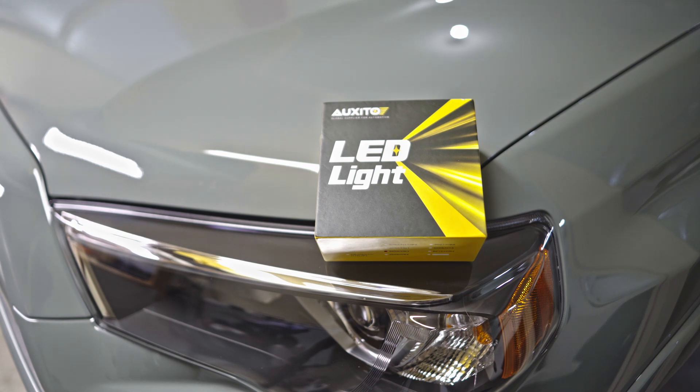What I'm going to do is replace it with an actual LED. The DRL will be deleted and we'll have a dual high beam setup. I'll be installing the Auxito LED Q16. On previous generation 4Runners, you could replace the bulbs on the high beam and low beam, but on this newer one they are sealed, so you cannot replace the actual bulb on the projector.